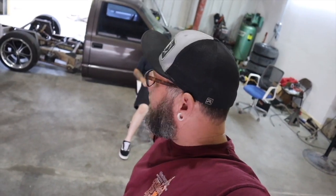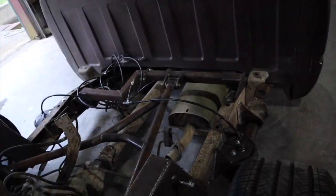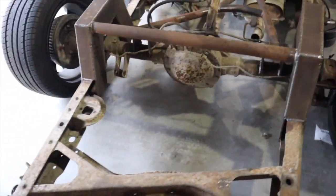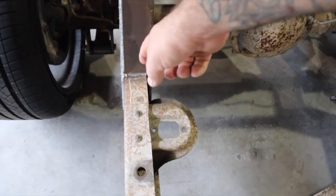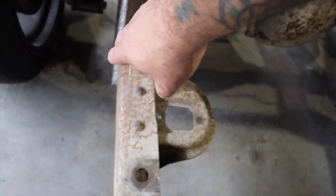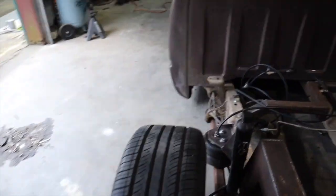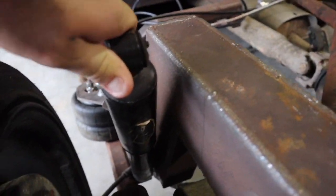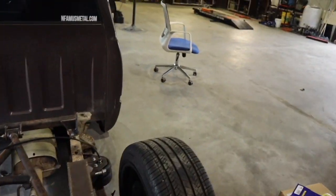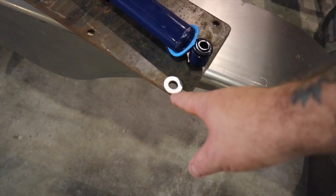First thing this morning - Jocks, with your infamous kit. Infamous's c-notch is already built and it's made to just cut the frame out and slide in. Ours is quarter-inch frame, ours is quarter-inch plate that welds to the outside. By doing that you create a rubbing problem, so what we're gonna do this morning is take some scrap quarter-inch that I have that already has some nice holes drilled in the same size as the shocks.